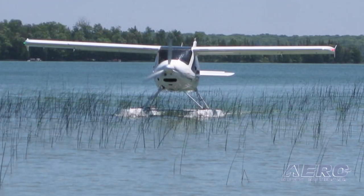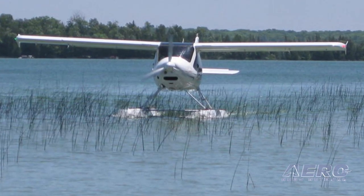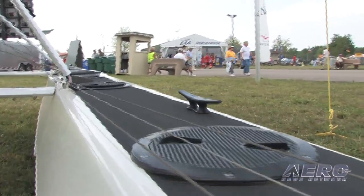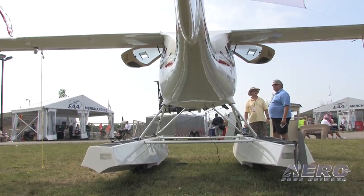What does it take to put an airplane on floats? It sounds like it's quite an involved process. For the initial installation, you don't know exactly how the airplane is going to react on floats. There are standards for where the center of lift is, where the center of buoyancy is, and what the separation percentage should be. There are things like water rudders and how they operate, and the degree difference between the angle of the float and the angle of the wings — there needs to be enough lift on the wing to get the float on step, and then at a certain speed it will separate. All these things need to be done by an expert in float installation design.